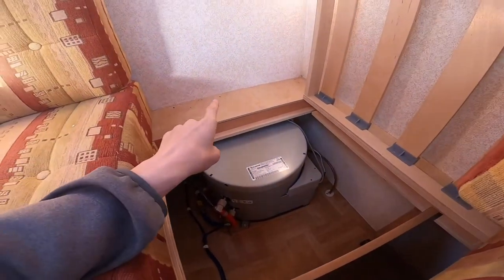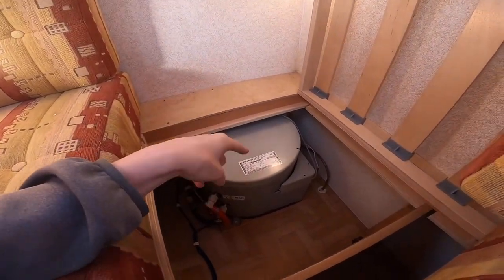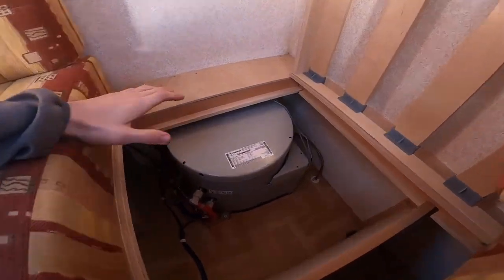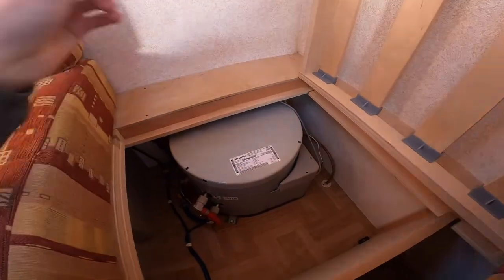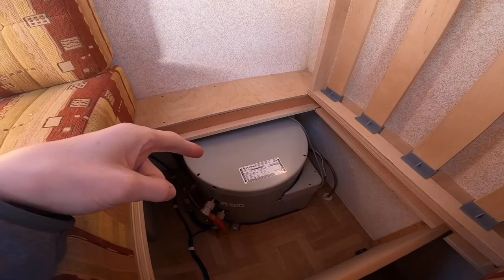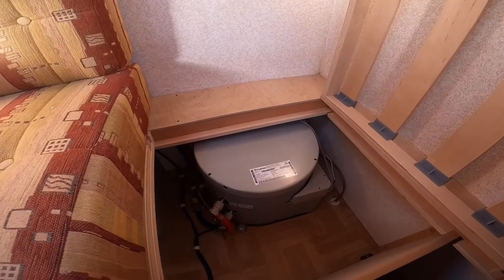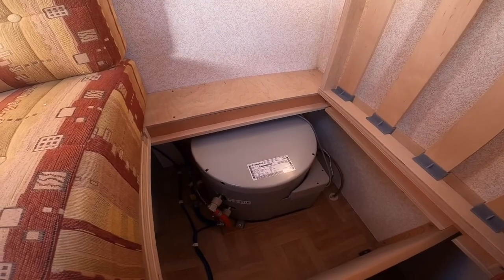In the back corner, behind where the vent is on the outside — the cover you take off when heating water on gas — is the location of the Truma boiler inside the vehicle. It holds 10 litres of water at any one time and refills from the fresh water tank underneath. In winter it's very important to eliminate all the water within the vehicle: drain the boiler, drain the fresh and waste outside, and leave all taps within the motorhome in the open position to stop water building up and potentially freezing when you get a hard frost.